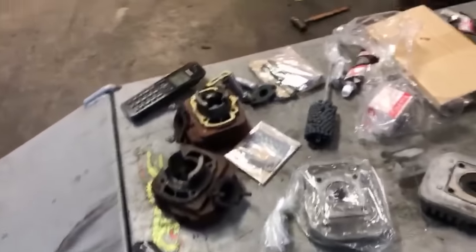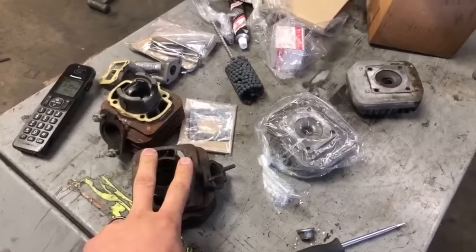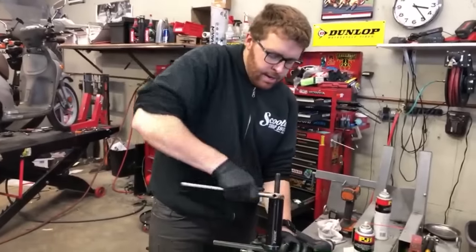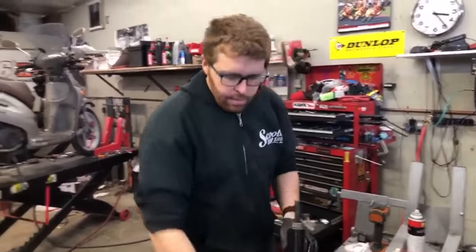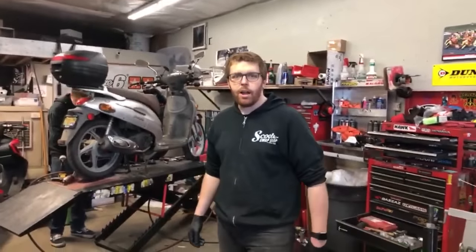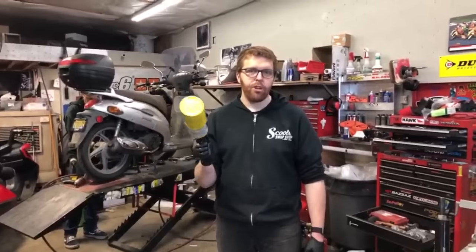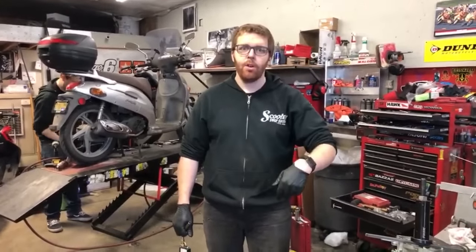Complete refresh, AF18, Japanese motor. So this is Brian's AF18 Japanese motor, AF27 I think. Does it help to chill the crank bearing? Yes, it does. We always have otter pops and bearings in our freezer at all times. You want to chill your bearings, ideally overnight, but you can get away with not. And then you want to use a heat gun or a torch to heat up your cases. Then the bearings, if you get them straight, they'll just drop in. You don't even need to hammer them in.